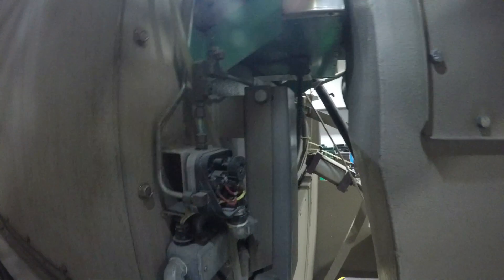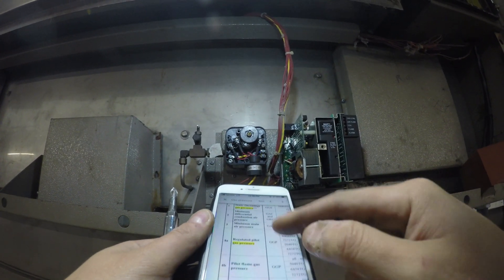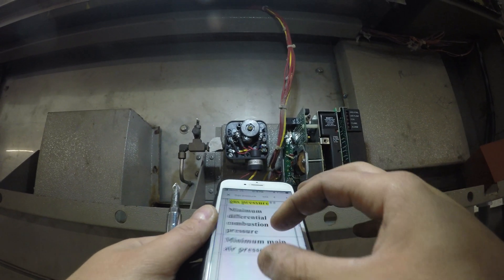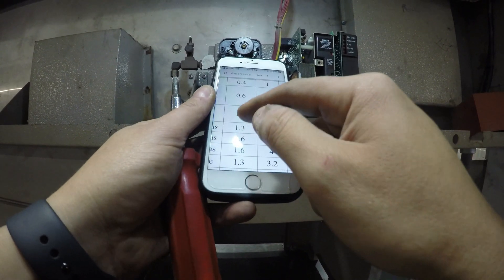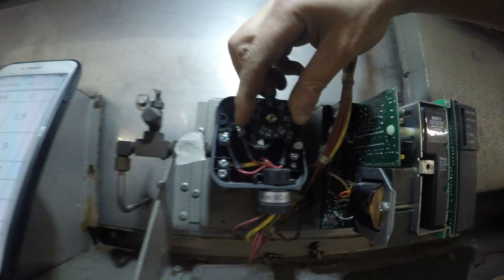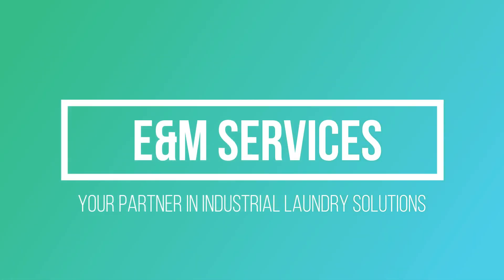That's pretty much all you need to do to set the combustion air pressure switch. The last most important thing to do is set the main air pressure switch, which is located on the loading side of the dryer right next to the fire eye unit. The book says it's supposed to be at 1.2. And that's it folks — please subscribe below for more videos. Thank you.